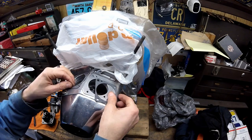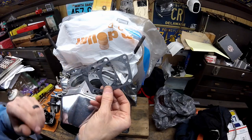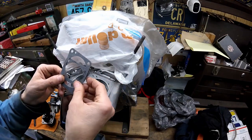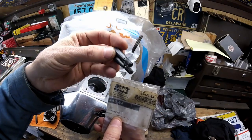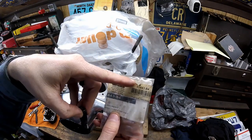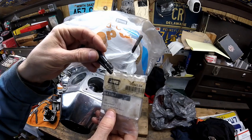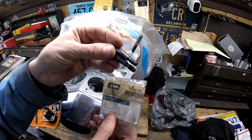I never add sealant because that's the purpose of the gasket — to seal. I would never spray anything on these. I see a lot of people online talk about doing that; to me, their surfaces aren't right if they feel the need to do that. I also use Jim's tapered dowels for alignment of the tappet blocks. The Jim's part number is 3344-3-84 — I'll put that in the description. These also work with the oil pump alignment on a Twin Cam.